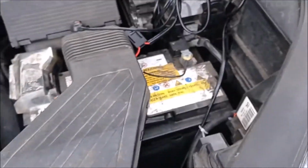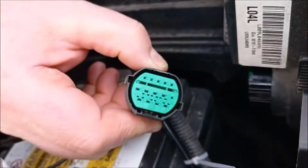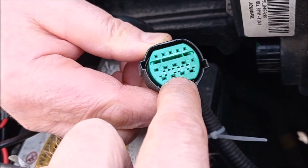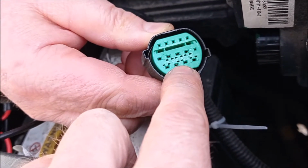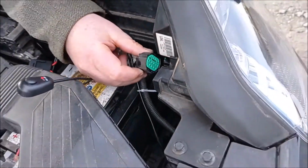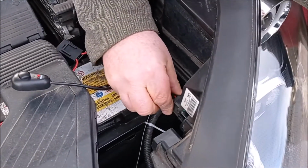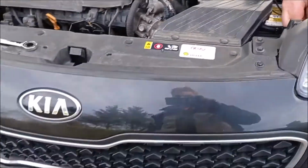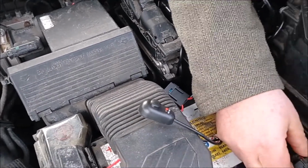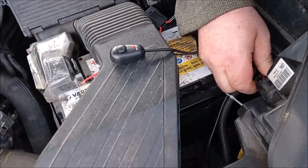Can you take that bit off, Adam? On I think it was an Australian forum, that you can hook this up. I don't know if it's this terminal, but it's the green wire that will activate, in theory, this switch for operation during the times that the main beam's on. So we need to look into that, but in the meantime, as this has just been set up to see how it works, let's see if there's a way through the firewall, and then we'll just put this switch for the time being in the car.